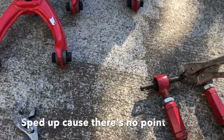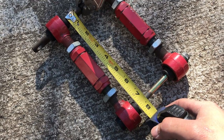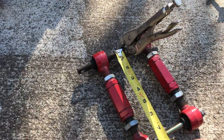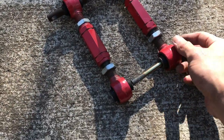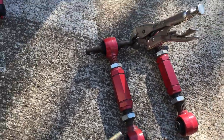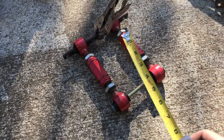I'm trying to adjust as best as possible here at home — I'm still gonna take it to an alignment shop. If I measure from here to here you can see it almost has seven and a half inches, and then if I measure from this side to here it's almost seven and a half inches too. I just use this vice grip to pinch them both down so they can be as equal as possible. You can see on this side it has seven and a half inches, and if I put it to the other side it should be seven and a half inches as well — yes it is. Now I'm going to put the lock nuts where they're supposed to go and then put it back in the car.